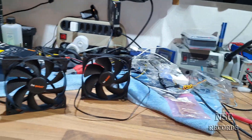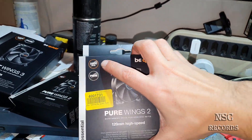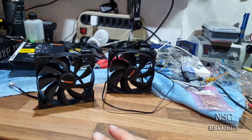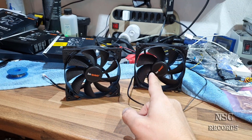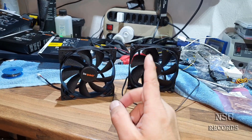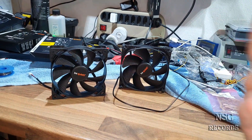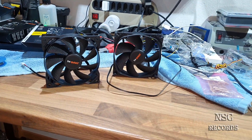That's also the reason why I'm doing this video - I had a fan turning at about 2000 RPM which was still too loud. Now I found really great fans turning at about 1500 rounds per minute. I recommend using a minimum of 1500 RPM because anything lower may leave your power supply running too hot.